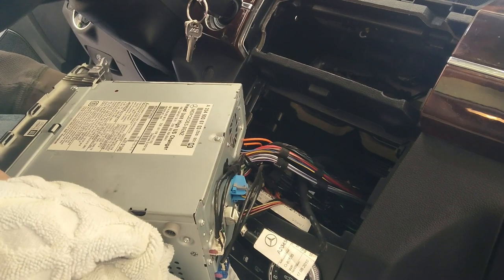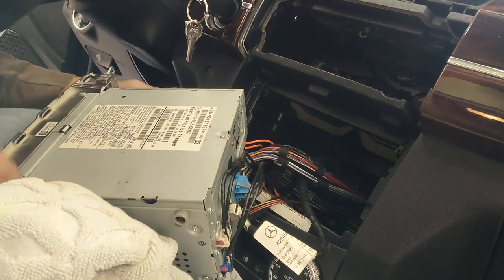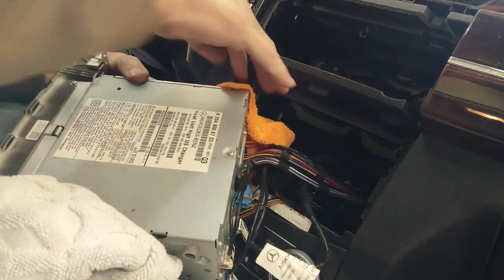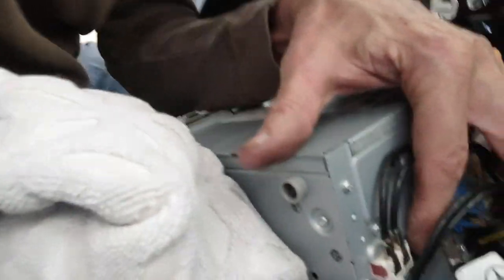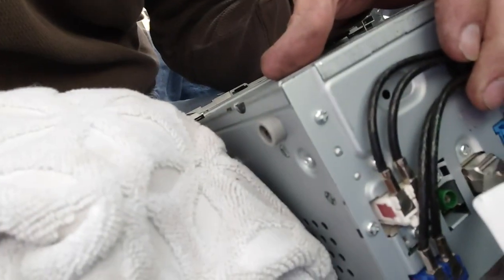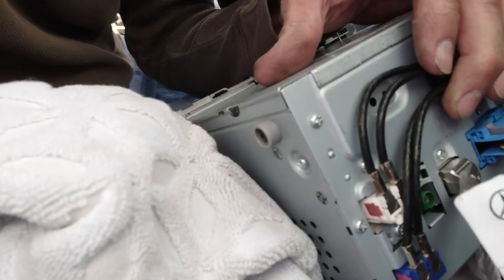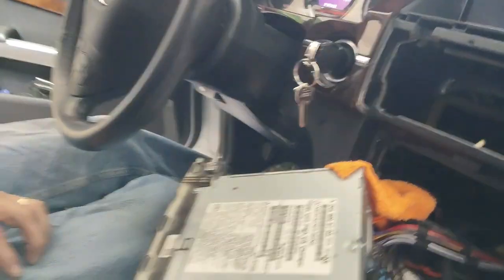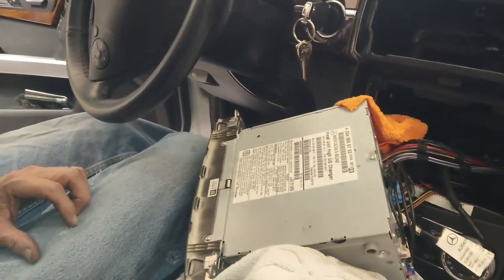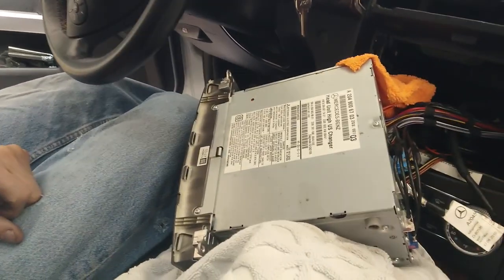That's kind of what we're dealing with, and I think that's far enough — we can get where we need to go. Just be careful not to rest the unit on anything that will scratch it. Here's the key: this little green connector right there is the one the camera plugs into. If you get to this point and you don't have that, something's very wrong — but I suspect you will. The trick is I'm going to test the whole system by hooking it up without installing anything, to make sure everything works before getting it in place. It will be much easier to troubleshoot if something isn't right.